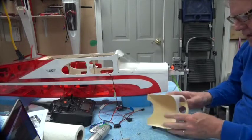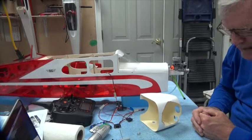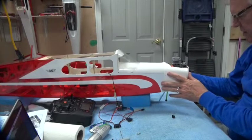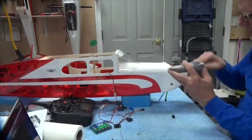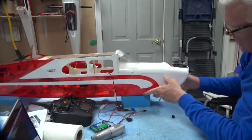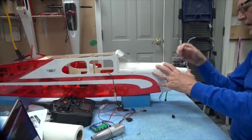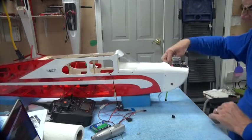So that's the cowl. I'm going to do all the epoxy work off camera. When you put this on, you have to be careful of several things. One is that this is underneath where the muffler goes, so you always have to make sure you come down far enough — you can see that's going to fit nicely there. And that it's far enough over here to be able to get to the tubing and to both the low speed and the high speed needle, which are over here. So I've left plenty of room to get my fingers in there.